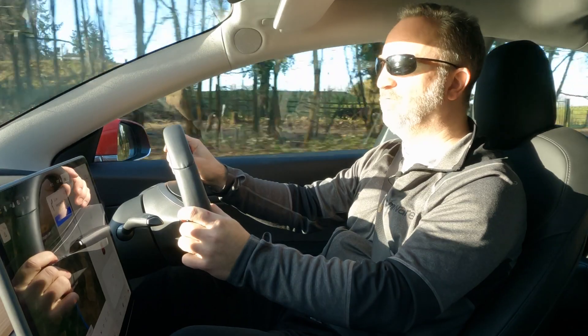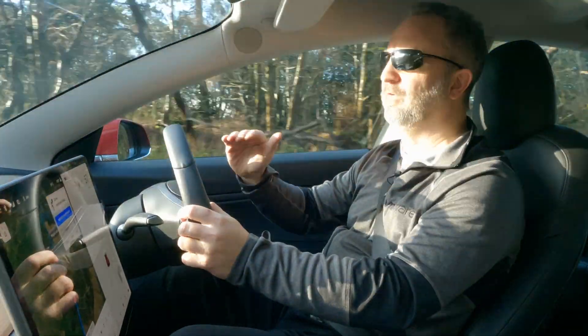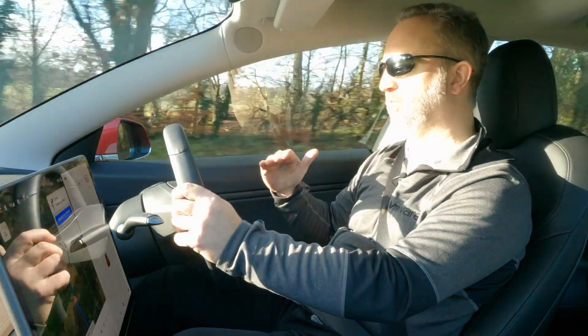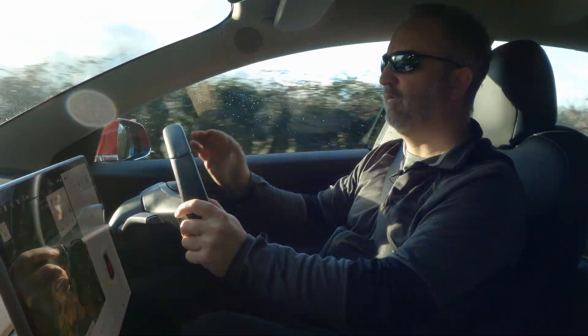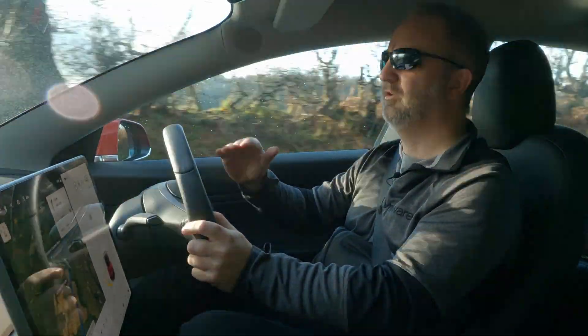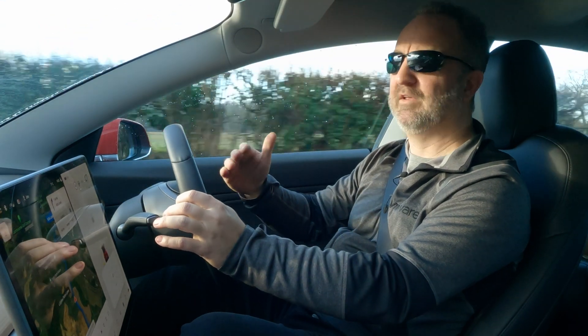First impressions driving home — a few minutes in the car, a few country roads, and more importantly a few little mini roundabouts to chuck it through. It's definitely sharper. It definitely feels firmer. This thing was a fairly firm and flat car to start with, but just in those corners, when I first turned in, it just feels dead flat — like it wants to be really, really flat. It's noticeable. Those anti-roll bars are really making a difference to me. But in terms of general driving, is the suspension harder? No, of course it isn't — we've not changed that. So in terms of use as a daily car, it's a great modification to put the anti-roll bars on to stiffen it up for those track days, but when you're just driving around, no difference at all. It just feels so planted. It feels like you're in a bit of a go-kart.